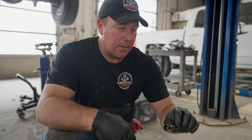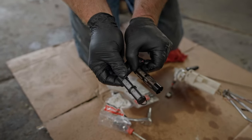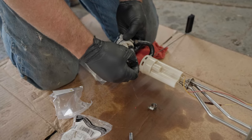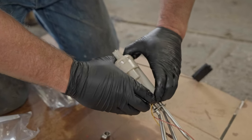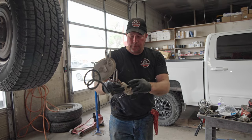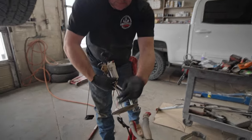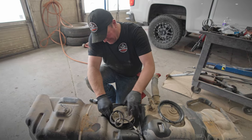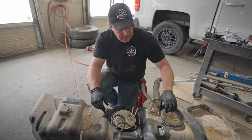New filter, old filter. We got this back together — we got the new foot on it, we got the new filters in here. We're going to set this back in there. There are two notches on this that line everything up — slide it in, try not to mess up your float. That pushes pretty hard against the bottom. Get the ring on.